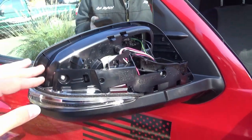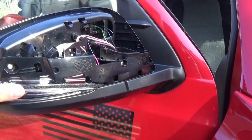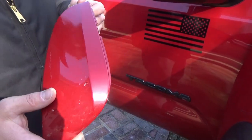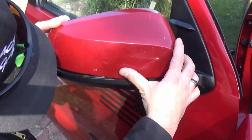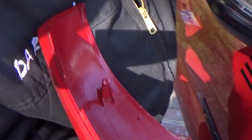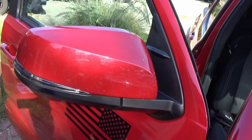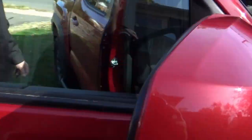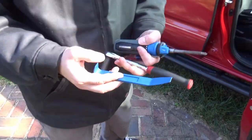Thankfully when the incident occurred the cover did not get damaged — it just kind of fell off and the plastic got bent a little. But all the clips are good, everything is fine. So we can salvage it and save the $40 to buy the OEM pre-painted cover. These just kind of fit on, swiveling right to left — there's a catch right here. So it looks like it goes in here first. That sounded good! And we are fully fastened, the mirror is tight. It folds, does all its things. Tools needed: a 10mm, a Phillips, a small flat head, and panel tools.